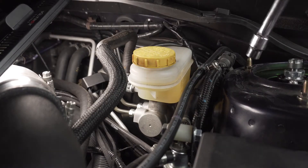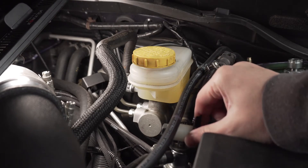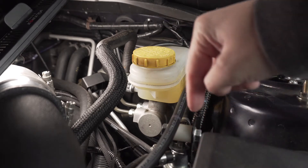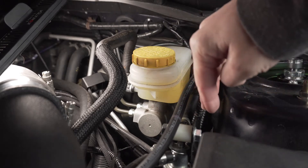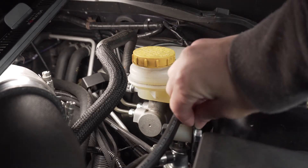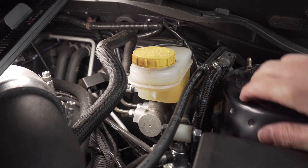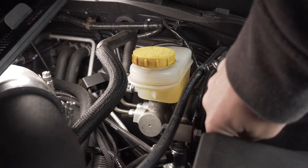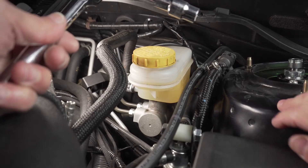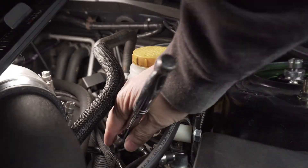The first thing I'm going to do is take this fuel line bracket that is here and loosen up those two bolts - there are two bolts down there. I'll just move the bracket, then put the brace here, and then tighten the bracket back into the brace at those two holes back down there. All the bolts here are going to be 12mm. I'm using a 12mm with a little extension so I can go around the lines and get this loosened up.